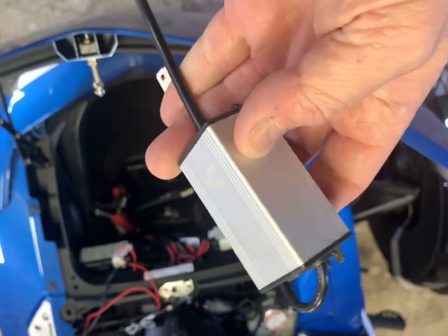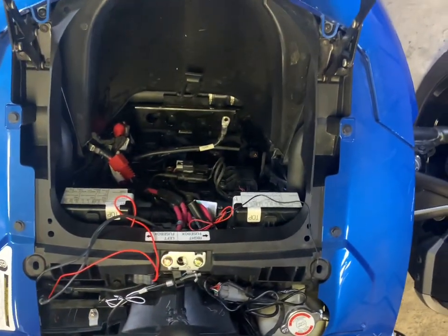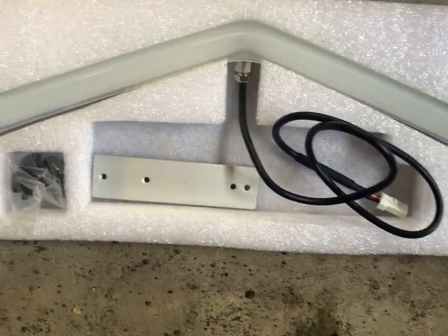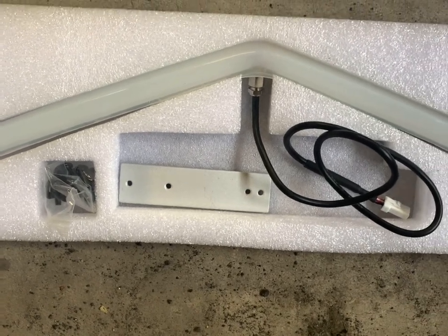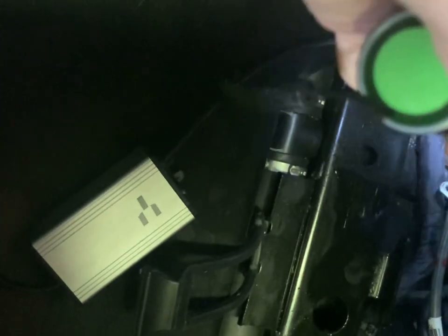The lights come with a power controller, which will be mounted right in here at the lowest point. It has marked places — you can't miss them once you look down in there with a flashlight — and it comes with all the brackets you need. I went ahead and connected the controller to the accessory port, but securing it there is pretty much impossible. I'm going to find some zip ties and secure it better before I put the battery back.